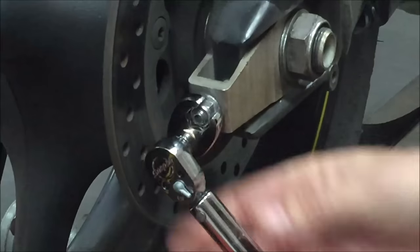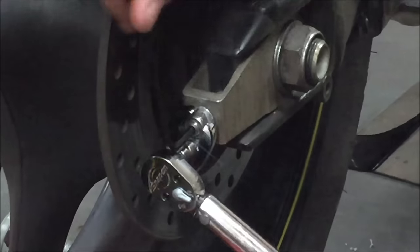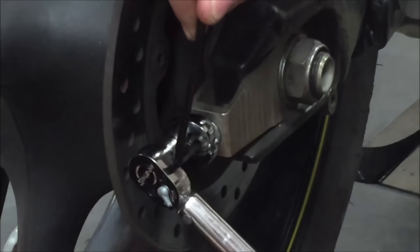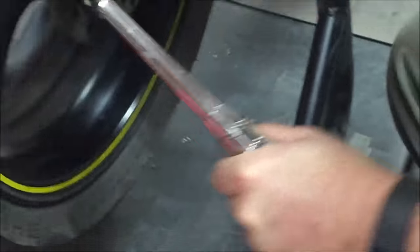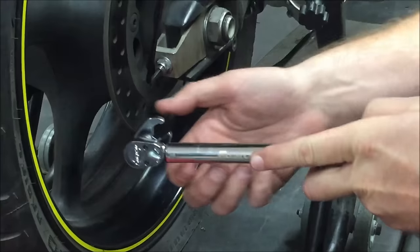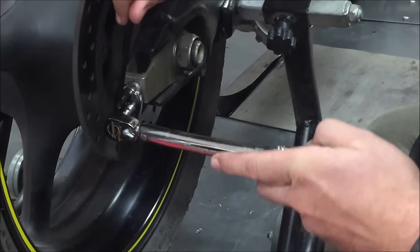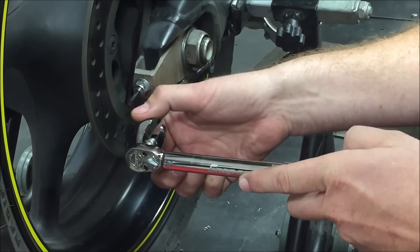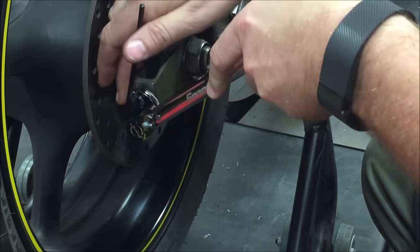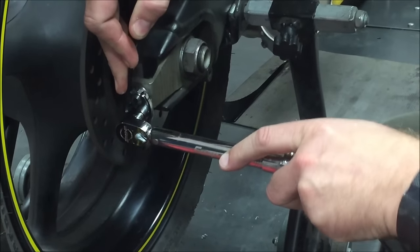So let's go ahead and model that quick here. Put this on, I'm going to put a little tension. I'll try and switch my hands so I'm not blocking it. I have to readjust, which is common on a crow's foot. My wrench has moved on me, so I'm going to make sure and get back to 90 degrees. Since I'm not holding my hand steady, it's moving a tooth on me, so I've got to adjust myself. I'm at 90 degrees. I'm going to get my wrench somewhere where I shouldn't have to make an adjustment again. I'm going to hold that — click — and I'm done.